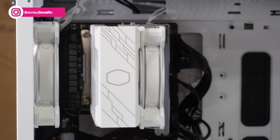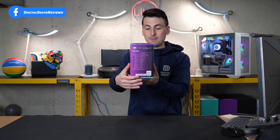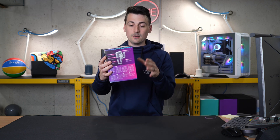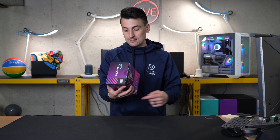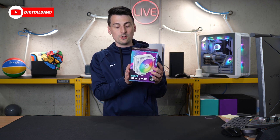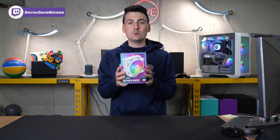If you're interested in this product or want to find out more about it, the link will be in the video description. Take a look at the retail box and packaging. Everything looks great. We have your tech specs on the side and a fantastic image and breakout diagram on the back and the sides of this cooler. Basically, this is going to work for Intel and AMD — AM4, AM5 sockets — as well as up to LGA 1700 for Intel 12th and 13th Gen users. Addressable RGB Gen 2, 27 decibels, 4-pin connector for the fan, and this comes with a two-year warranty.